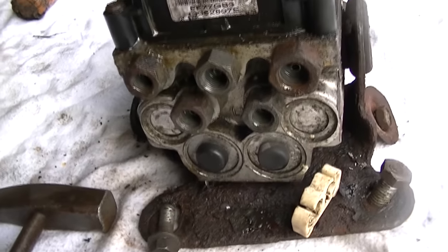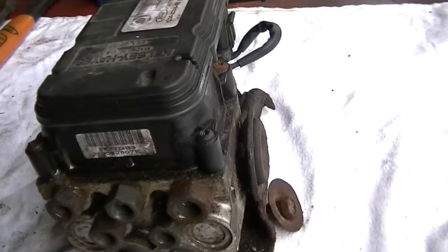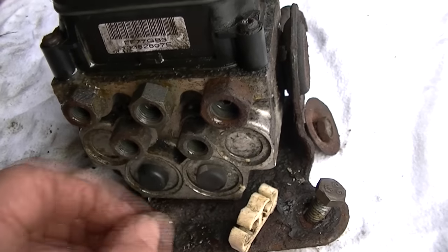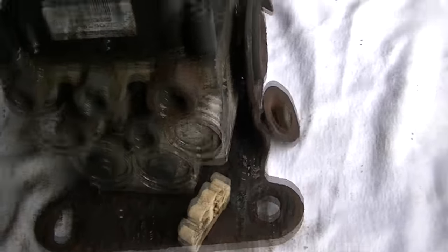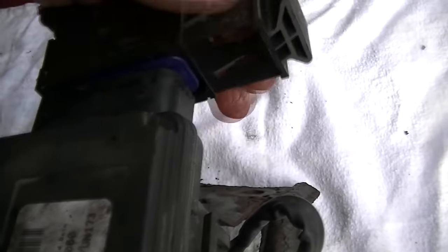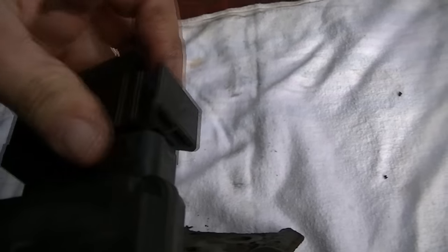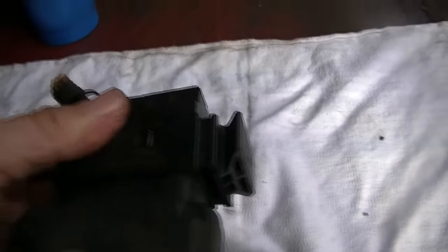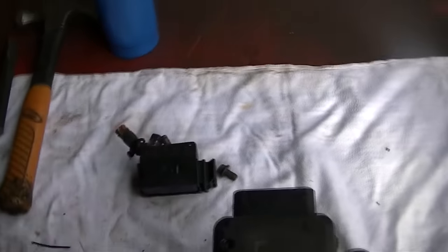Once you get the two bottom lines off, pull them off to the side. At that point you'll have a couple of mounting nuts on the fender — these are 13 millimeters. Get a deep well socket in there and take those out, including one on the back side. Then you have this plug in the back which fooled me for a while. Notice on the side there's a tab that slides out — you have to pull out on this to release the plug, and it slowly lets the harness come off. That's kind of an interesting design.